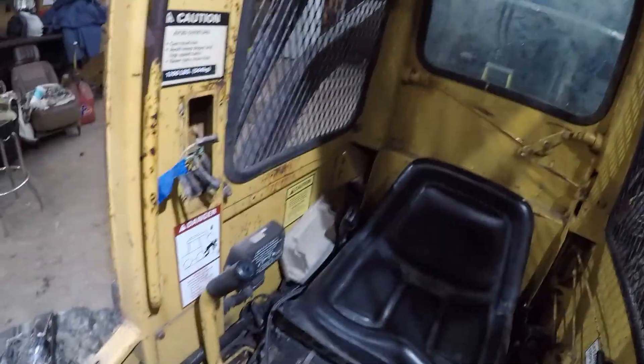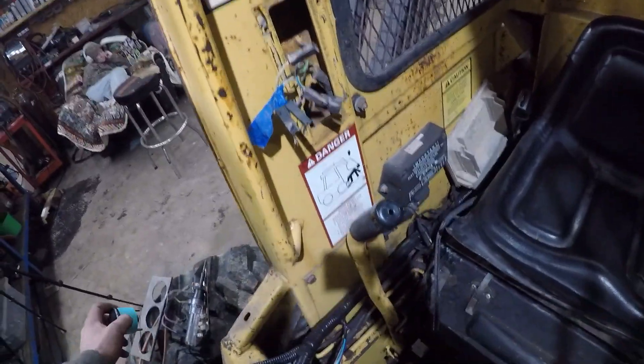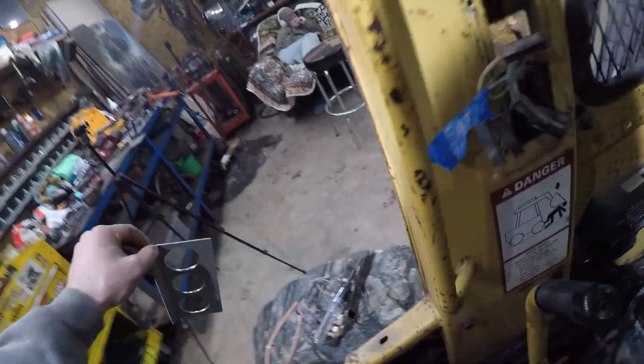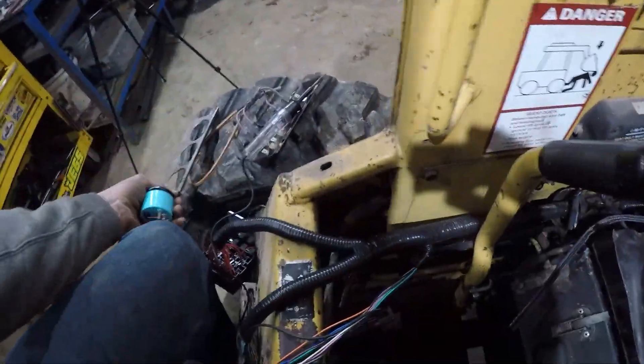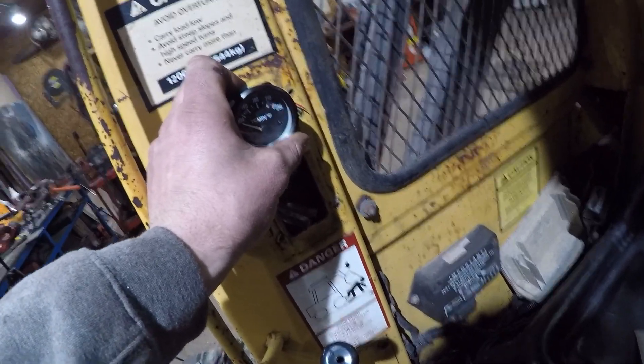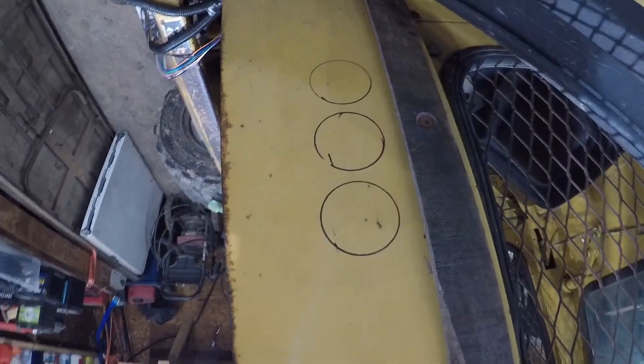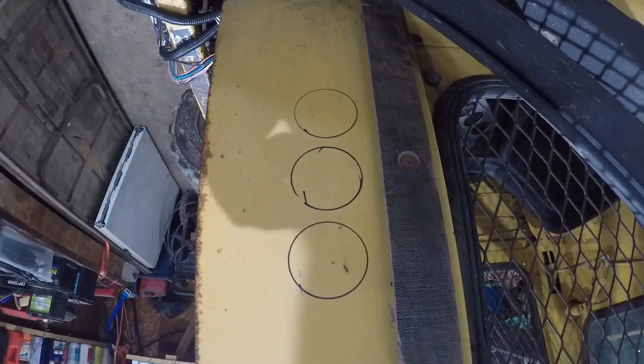I'm going to cut this out. My plan was to take this plate in there, but once you're inside the cab I don't like losing any room — cabs are already small enough and I'm six-foot eleven and a half. So my plan now is to take this plate, weld it in there, cut out where it needs to go, and on the back side make a plate for access. It'll look a lot better and have more room being flush like this. I've traced out where to cut — I'll cut a big square out and bolt a plate over it.